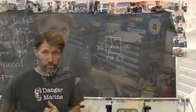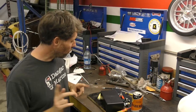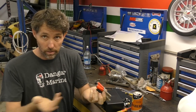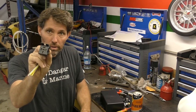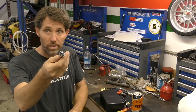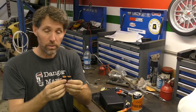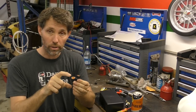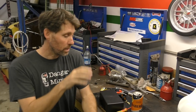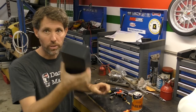We'll go to the bench and I'll show you what I bought to build this. I've got a couple of reasonably large alligator clips that I'm going to be putting onto a car battery to use the tester. A socket for a relay, so I'll wire this up and then we can just plug the relay we're testing in. Then I've got a fuse, just to fuse the whole thing. Two 12-volt pilot lamps — one to show power coming out of 87A, one to show power coming out of 87. Then I've got a switch to activate it, which will send power to pin 85. Lastly, just a project box to build it all in.